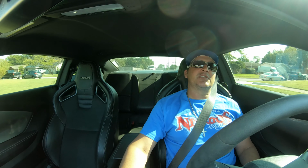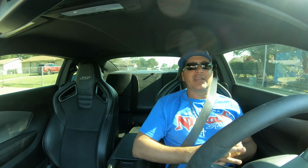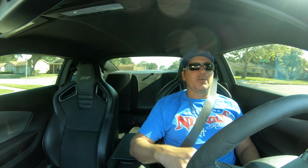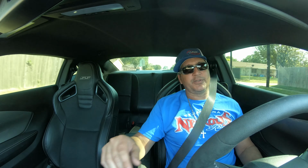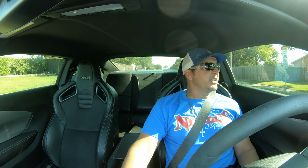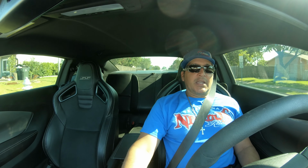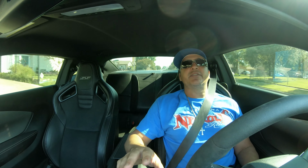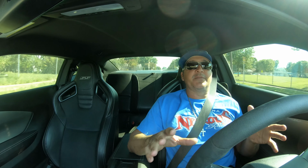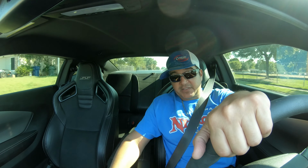It picked up, I would say, about 178 horsepower. I didn't do it before and after, which is a shame. But a lot of these 14s that we've gotten in make anywhere between 349 and 360, depending on the weather outside. I'm talking about a bone stock car, not somebody who added headers and a tune and is trying to be sneaky. When you slap on a Whipple, you pick up between 178 and 200 horsepower, depending on what your car did from factory. This is a big pickup.